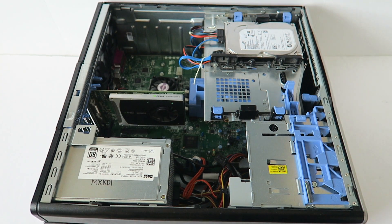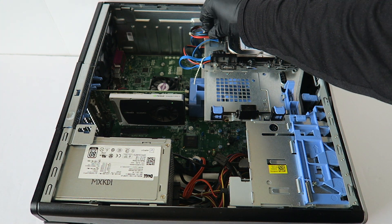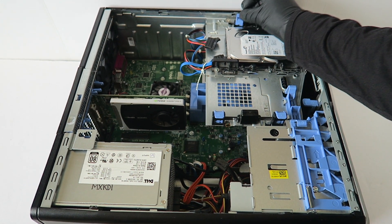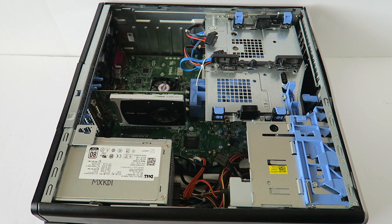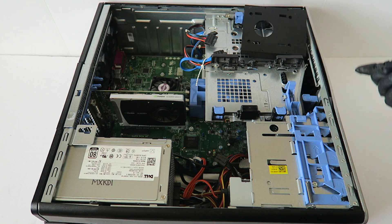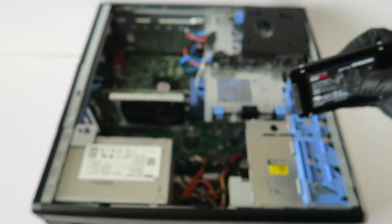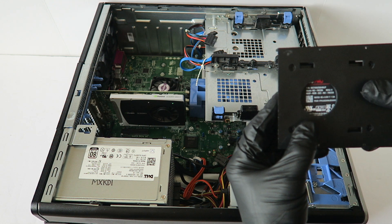So remove the side cover panel. I'm going to go ahead first to disconnect the SATA power cable from the hard drive — there are little tabs where you lift them up like this. I'm going to be using a caddy, it's a 3.5 inch to 2.5 inch, and I'm going to be using the Solid State Drive Samsung — this is the 850 Pro 256GB. What I have to do is take the caddy and install the screws in the back.